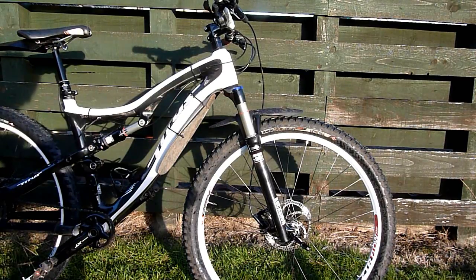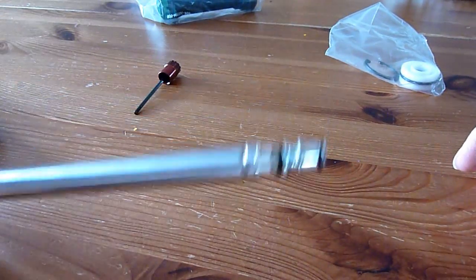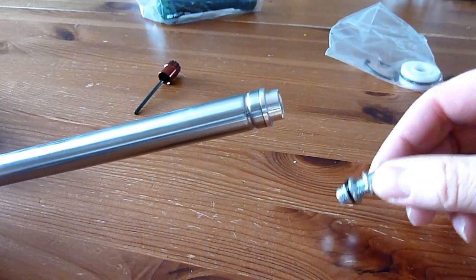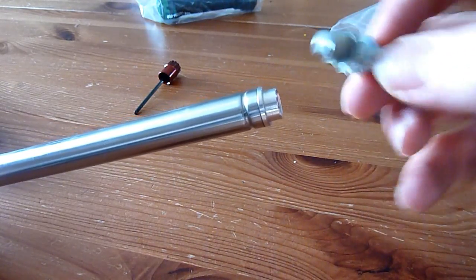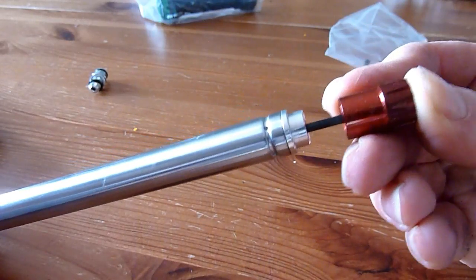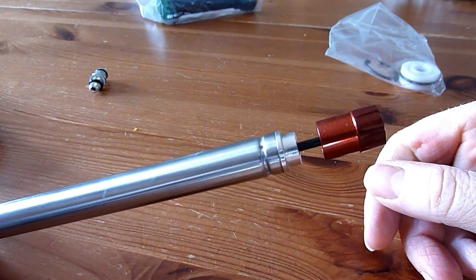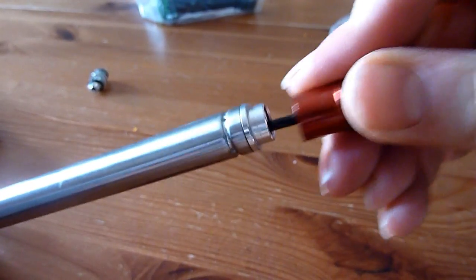What we'll do now is look at the actual damper that's inside those shocks, since we've got one in a bag. This part here is normally the piece that protrudes from the bottom - that's where I was sticking the adjuster. We'll take that off to make it easier. It normally goes on to the bottom here and is kept in by this little black ring. This has to be pushed in like so, and to make it slower you push it in and twist - that's it. That's all the adjustment there is, maybe 30 degrees of 360.